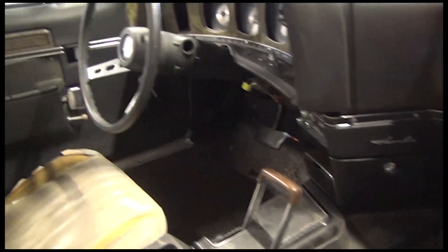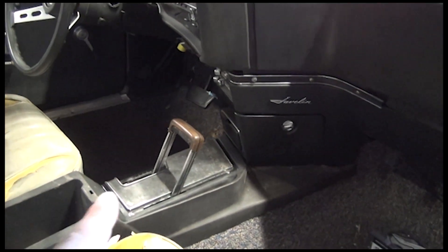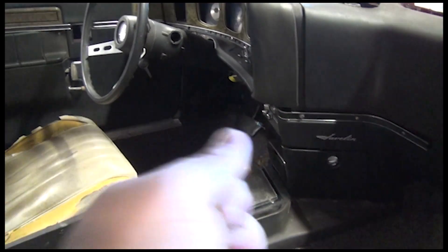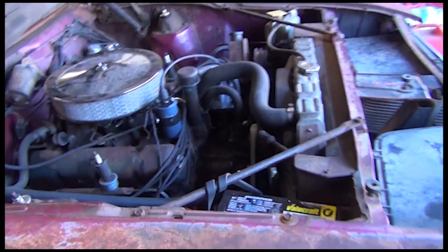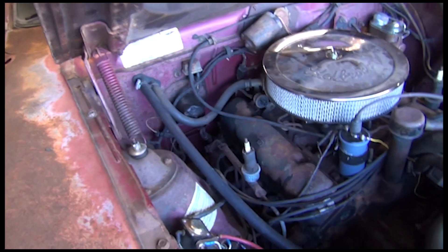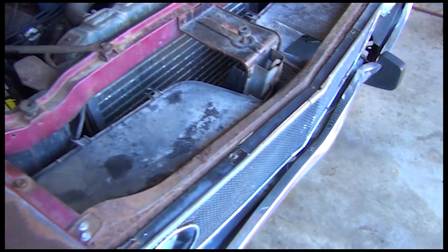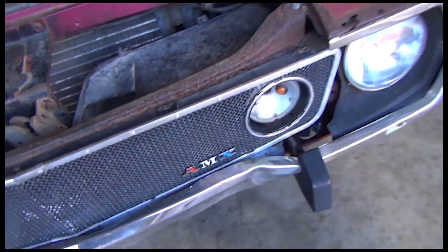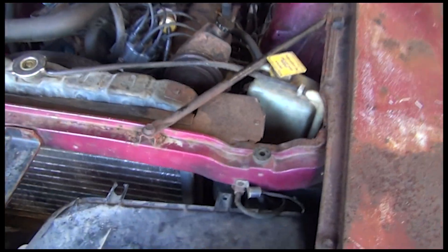It's not a bad little car — it's a factory AC car. The shifter is not working correctly; it doesn't latch, so you can just grab it and slide it back and forth, which is not how it's supposed to work. It's got mismatched tires in the front and the big old 304 V8 in it, which is what the VIN claims. We'll have to do a numbers-matching check. The inspection sticker is there, and there's the ambient air intake for the AC unit.